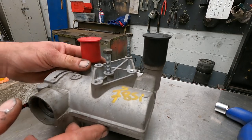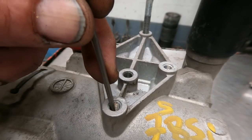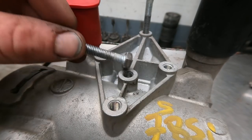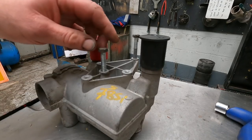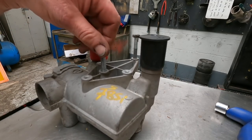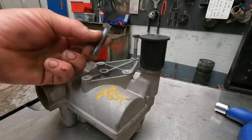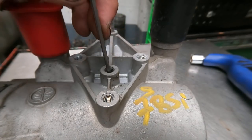The fault with it was it was leaking air back through the red line when the red line was taken off, and the brakes wouldn't come on. The problem is these are blind holes, whereas this bolt - you can see how long it is - was bolted into the valve. The body on this valve is actually where the bolt should stop, so this was screwed all the way down and that cracked into the valve, hampering the operation of the valve itself. I'll show you here - it goes right the way through.